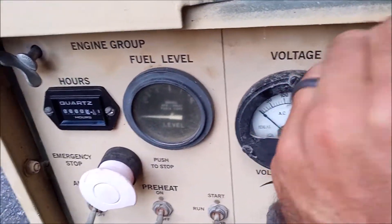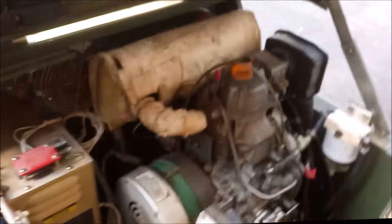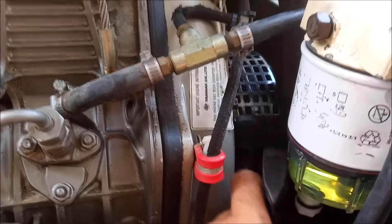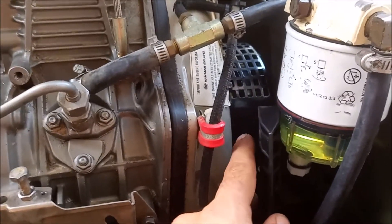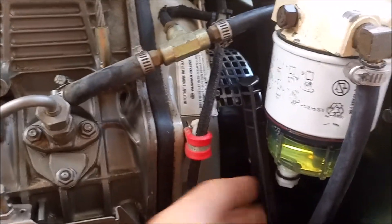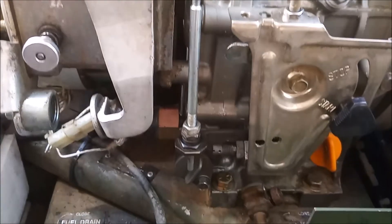I also posted a second video on adjusting the governor. I'm still tinkering with figuring out if the gauge or the sender is bad. I got the pull start on here — I originally wanted it to come out over the side, but since all I could source was a Chinese copy for the 186F clone of the Yanmar motor, when you have the rope stretched out and tied out there, it was engaging and as the motor ran it was actually tapping the metal pawls inside, causing sparks and noise — which is dangerous if it grabbed, it could obliterate itself. So I just tucked it in here; it's fine and you can still get at it when manually starting.